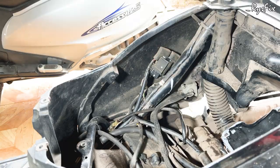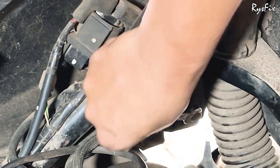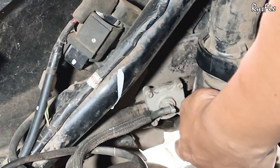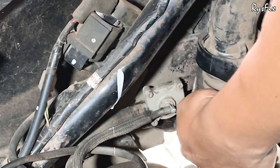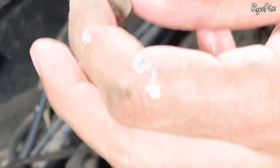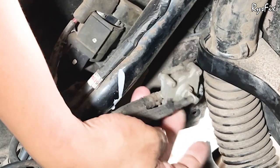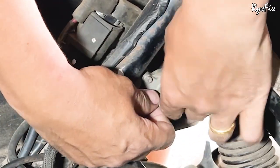To replace the fuel cock, you will need a 10mm spanner. Take the 10mm spanner and loosen the bolt. Once you loosen it, you can easily take it out with your hands. If there is too much petrol in your fuel tank, take it out and empty it, or you can take out the cock and immediately replace it with a new one.